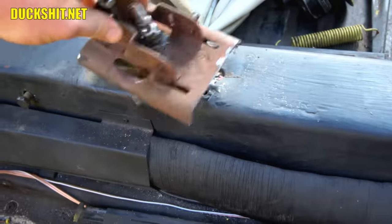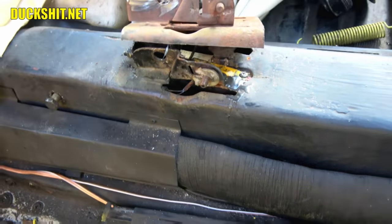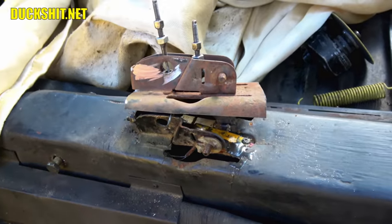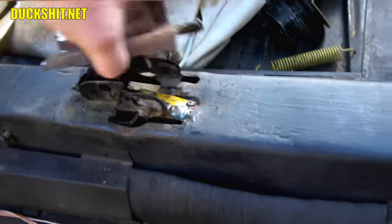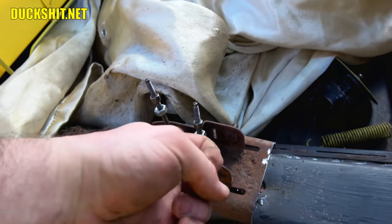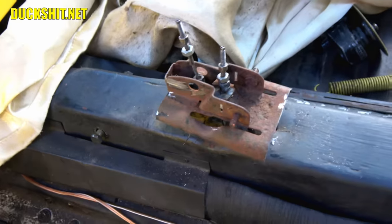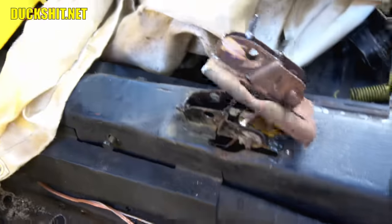All right, that's how it's going to go in there. There are double layers of metal, which we talked about, so we're going to weld the crap out of it and get some deep penetration on it. Should be fine. And the inside plate is only tack welded in a few spots anyway. I think it's just designed to stop the whole thing from pulling out through the chassis. All right, here it is. That's where we're going to be, getting ready to start cutting in here.